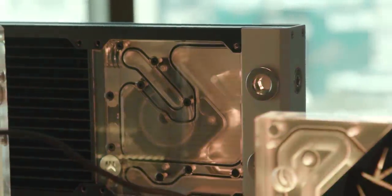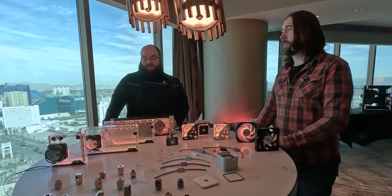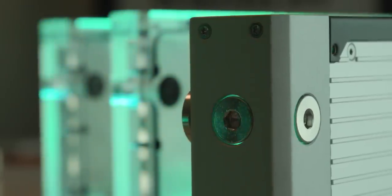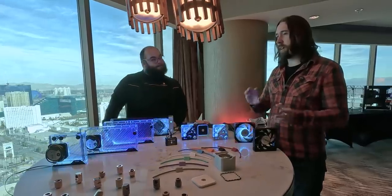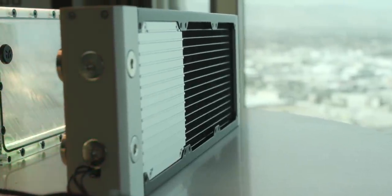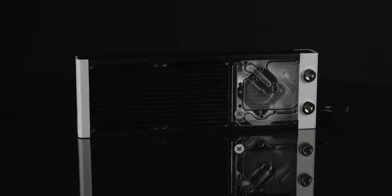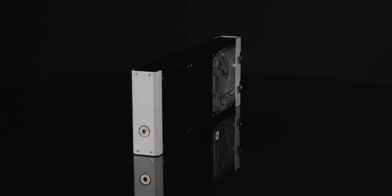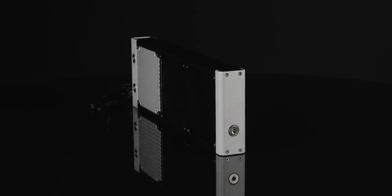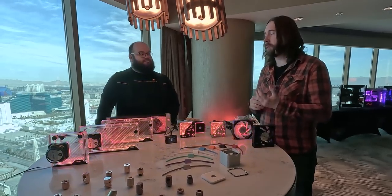You could just add a block to it and you have a whole loop — just a CPU block or just a GPU block — or you can expand it with more radiators and build a whole system, using that to hide your pump reservoir. It can be flat with the pump on the underside, or ideally vertical with the ports at the top. They have six ports — on the back, on the front, and on the end — so you can set it up with the plexi side facing out or into the case, and use the leftover return ports as the fill port.